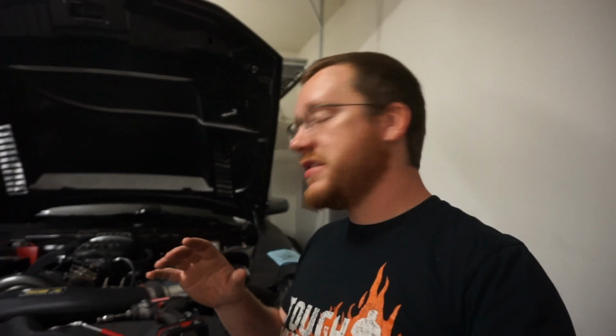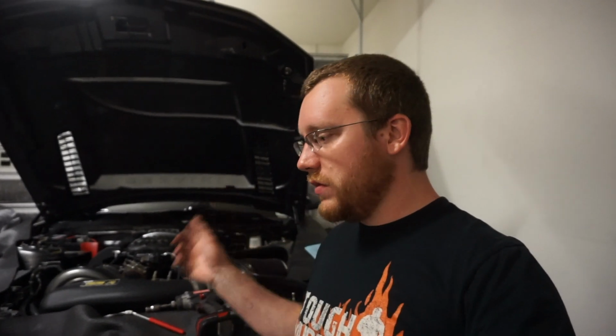I just want to take a quick second and give a huge shout out to Eric Rockwell. I was messaging him, kind of bitching and moaning that I hadn't been able to start the car, bouncing some ideas off of him. He was like, have you tried this, that, and this? And I did a couple things based on what he said. Checked the terminals on the starter. Wasn't getting power for the clutch side when we went to hit the start. So I traced it back to the clutch switch. That's how I figured that out. Again, big shout out to him. If it wasn't for him, it wouldn't be started right now. It'd probably be another week before I even tried.